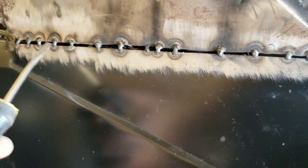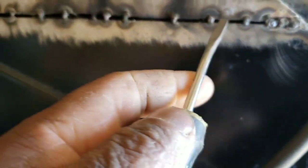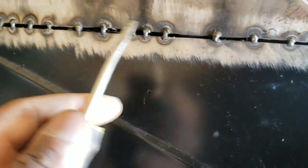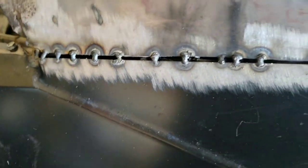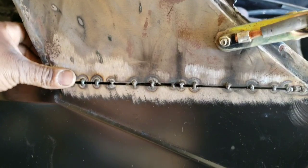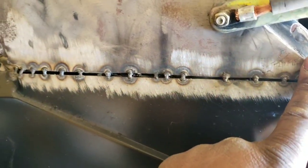I'm filling in this gap on sheet metal. Once you get your sheet metal aligned, do a small tack and place your tacks out throughout the whole panel. You don't want to rush this — even though this is a small area, it could take me up to like two hours. The main thing is you don't want your metal to get too hot and start warping.